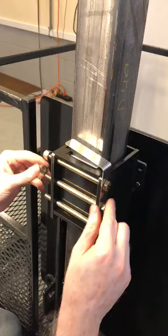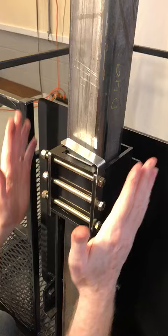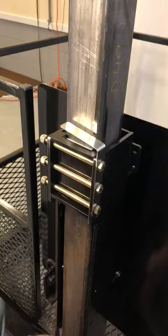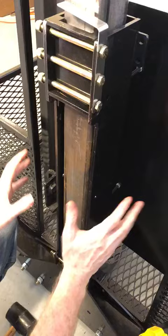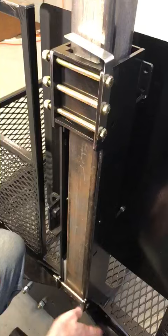All they're really doing is holding this plate in place. You've got these three top collar bolts holding the back plate and everything in place, and you've got this one just on the bottom. This bottom one is the bolt you're going to loosen or tighten to control any shift around the axis of the column. Tighten the top three bolts down and leave this bottom one loose for now, and you'll be done attaching the column. The next step will be the cables and such.